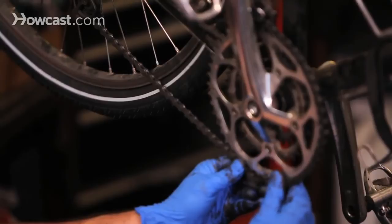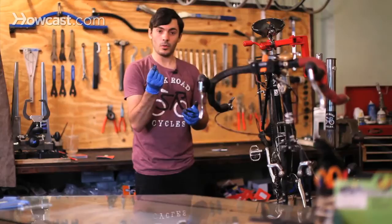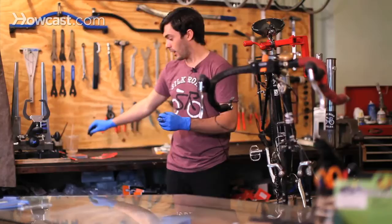The way to put together this chain is they use a pin. It comes in these little packets here. Different chains require different installation. This chain requires a pin, which you'd have to get at a bike shop according to whichever size chain you have, and this is a Shimano specific pin. They also have quick links, which I demonstrated before, so these are the quick links. Or the chain may already have the pin installed on one side, just coming out of one side of the chain, and then you can push it through